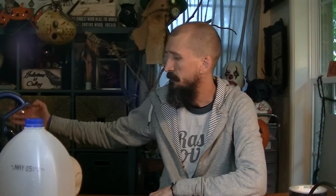Now let's go over some safety rules or precautions. These are more like guidelines, but they'll keep you safe. It'll keep your vacuum cleaner safe and your house and your circuits and everything. So first rule, a normal heat gun draws about 1,000 to 1,400 watts, but so does the vacuum cleaner, right? So if you're plugging it into the same socket, that's going to be too much of a load on your circuits. So what we're going to do is use the heat gun, then turn it off, then turn the vacuum on, turn it off. Heat gun on, off, vacuum on, off. Not at the same time, because it just draws too much electricity, and that will keep your home safe.